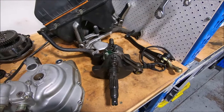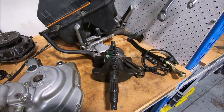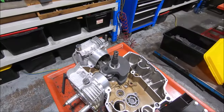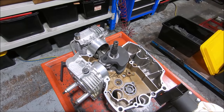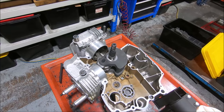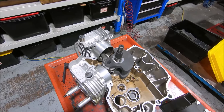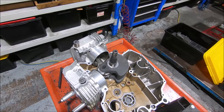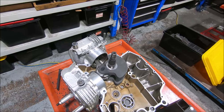So this ST2 crank had the plug coming out, filling the main bearings up with steel shavings, so this engine has got all the bottom end bearings done. The crank was ground and we're using Toyota 4AGE big end shells. You can get those shells from ACL in their race series. The race series means that where the ends of the bearing come together on the part line of the rod, there's more clearance.